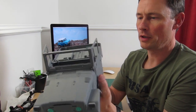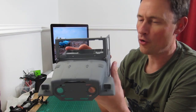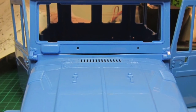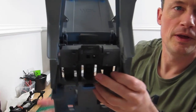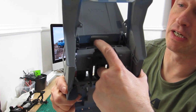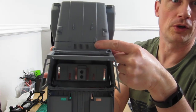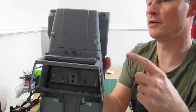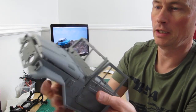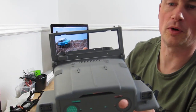A couple of bits to note. The scuttle underneath the windscreen had a horrible bow on it — I'll flash a photograph up so you can see the bow. The quick fix, or the bodge in my case, is: if you look on the underside, you can see this lip here which is part of a black plastic insert that normally gives some black shading behind the grille. What I've done is got some plastic card in there and basically used it to jemmy the scuttle plate up so that I've got a pretty good parallel line there. I'm quite happy with that.